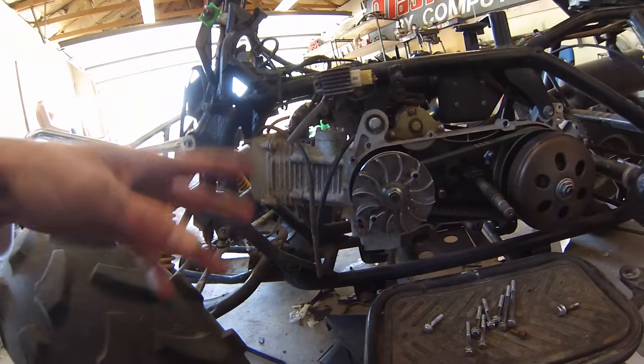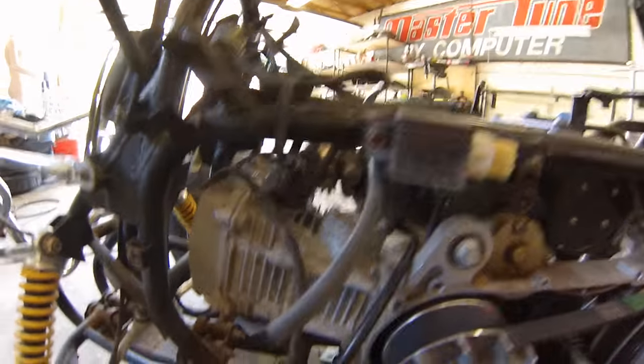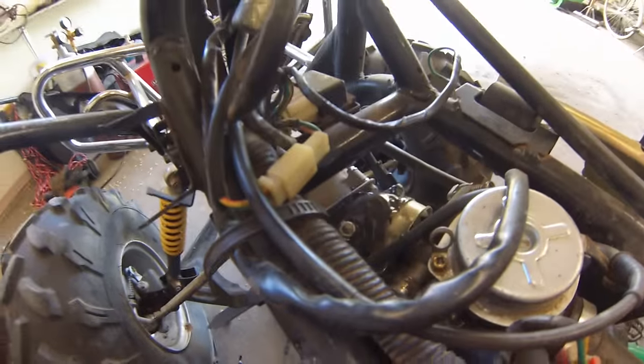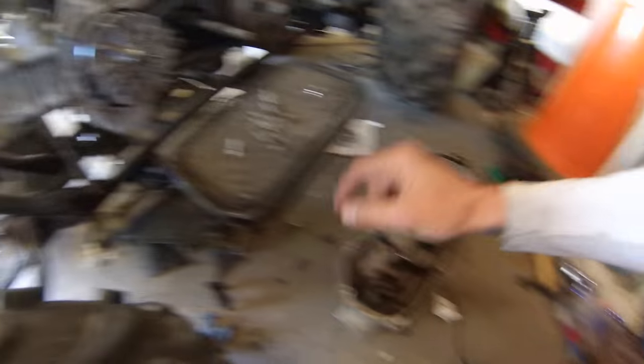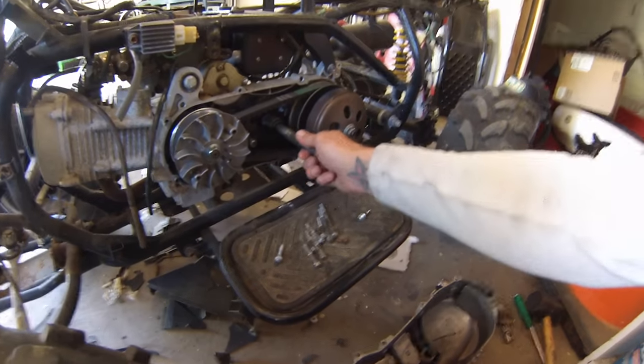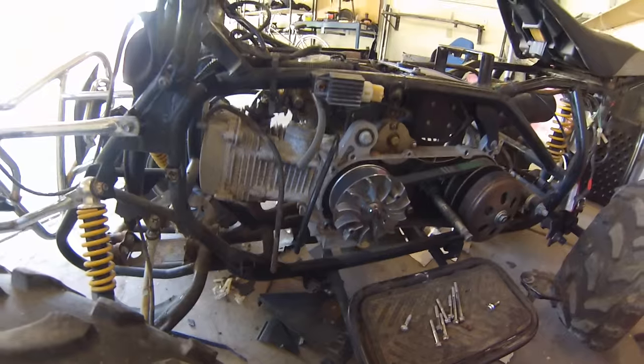As far as the chugging or the improper jetting, the intake manifold itself is made of plastic, so of course it was just riddled with cracks. I JB welded that yesterday and it's been setting up all night. So now the next step would be to put this cover back on, make sure that pin aligns correctly so the kickstarter will actually engage the kicker gear, run some fuel to it, and it should just start.